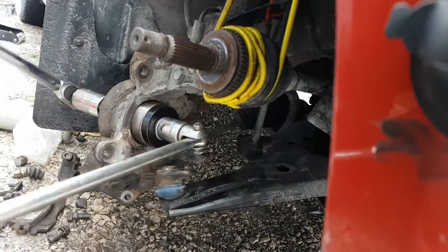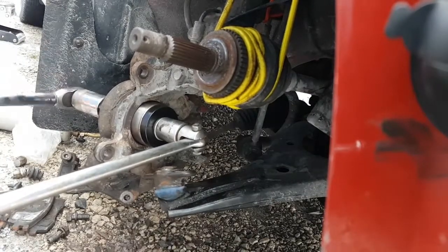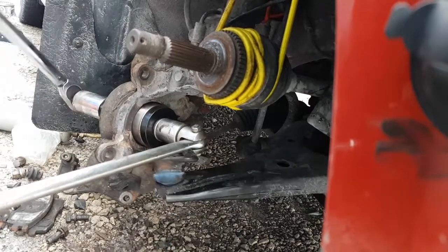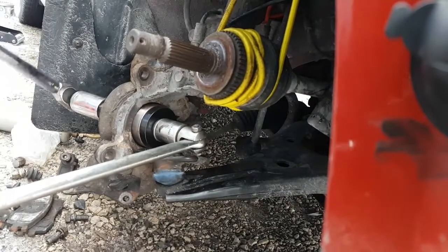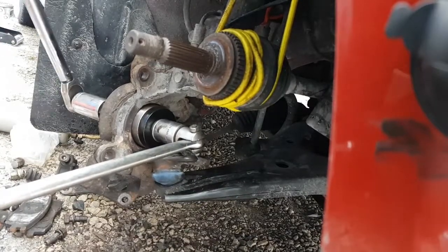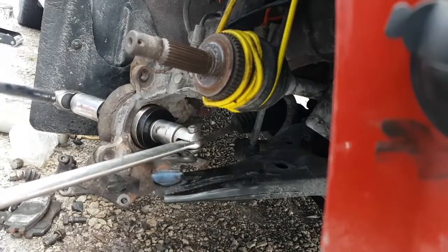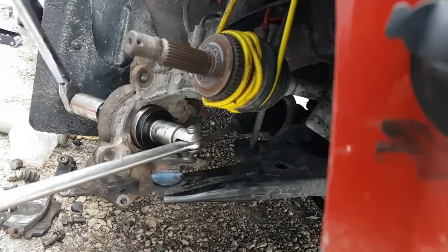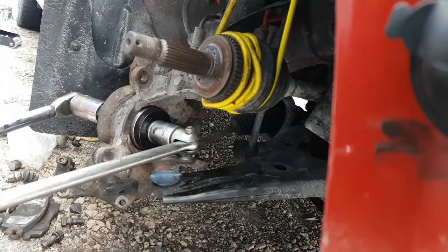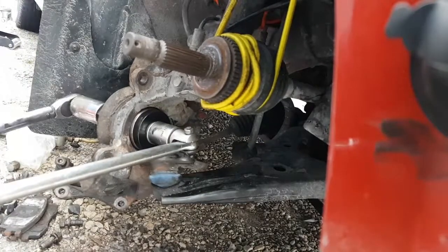The ratchet almost goes down on its own. So let's see. Keep going. Should get tighter as we go. Yeah, it's starting to get a little tighter now. Still nothing terrible. Like, it's literally no force on the ratchet. And that's what you want. You don't want it to be crooked. If it's really hard, it's going crooked. You don't want to do that either. Really easy. Like, there's literally no force there.